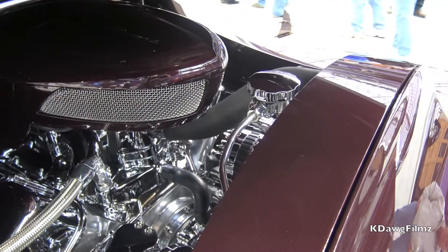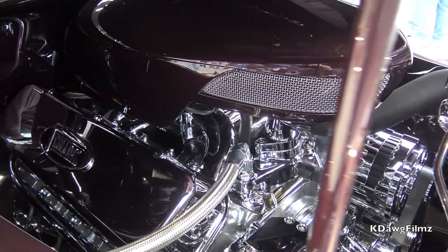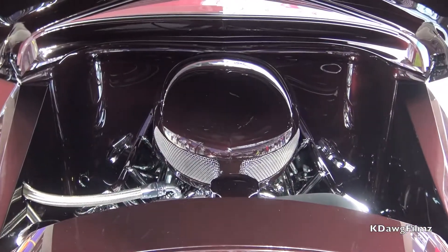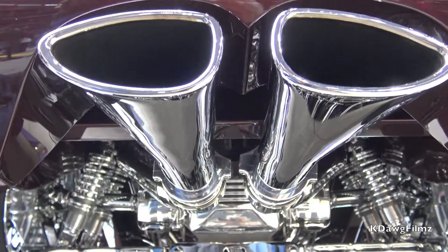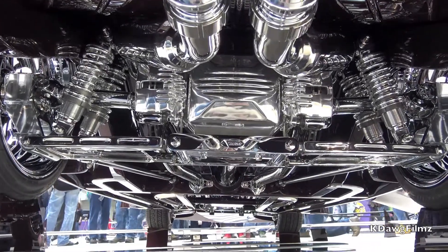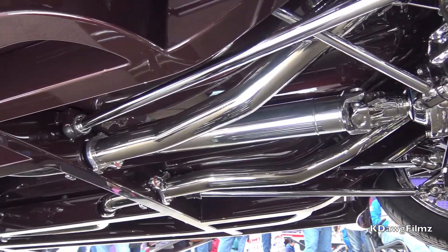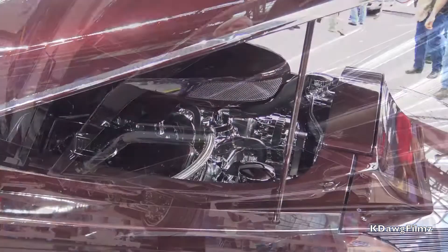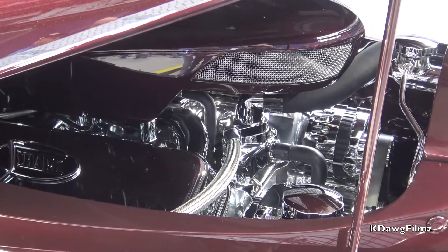Underneath the hood, we have a big block Chevy 540 dark polished aluminum engine with a lot of chrome pieces on it. The air cleaner is custom-made for the car — it's a play on our fenders as well as the nose of the car. In the rear, we've got a Jaguar-style independent suspension system made by Kugel Components, and we're also using their independent front suspension. For the transmission, we're using a 700R4 automatic transmission, and the engine puts out about 578 pounds of torque off the line.